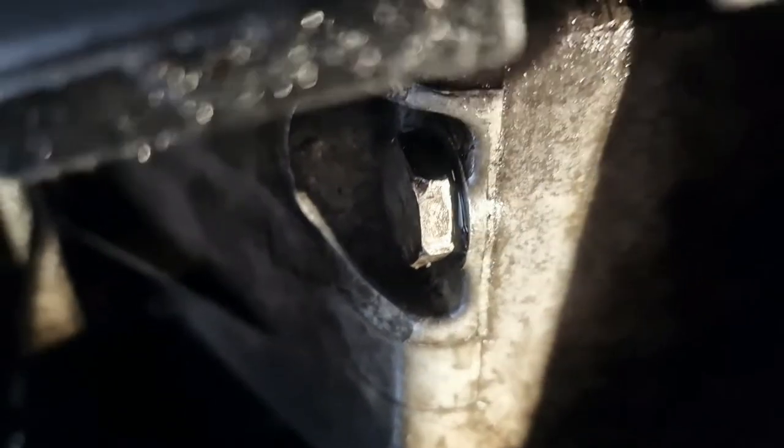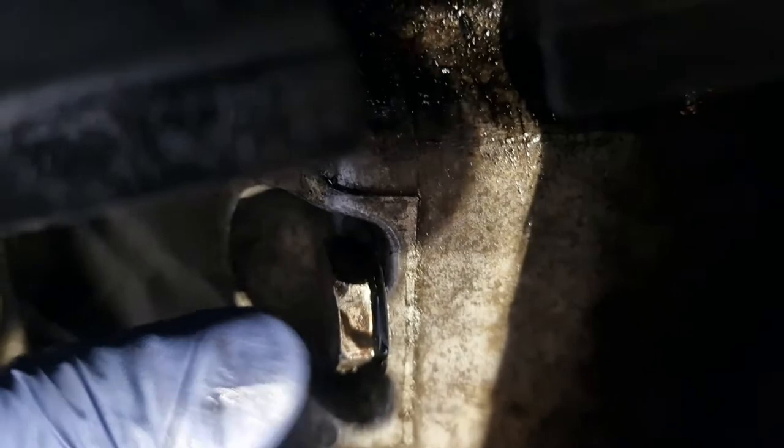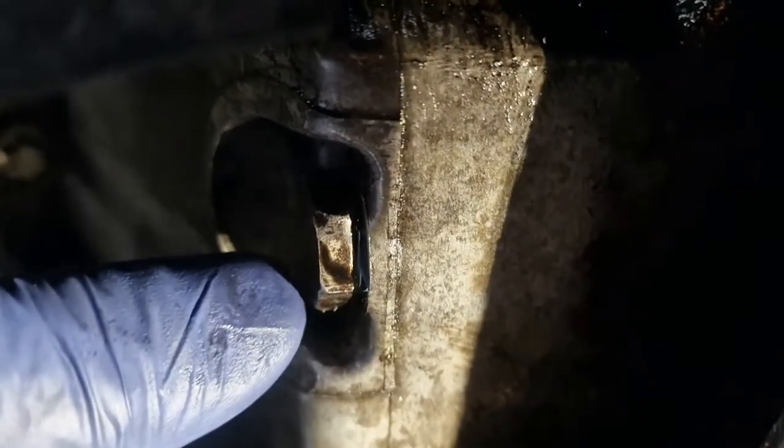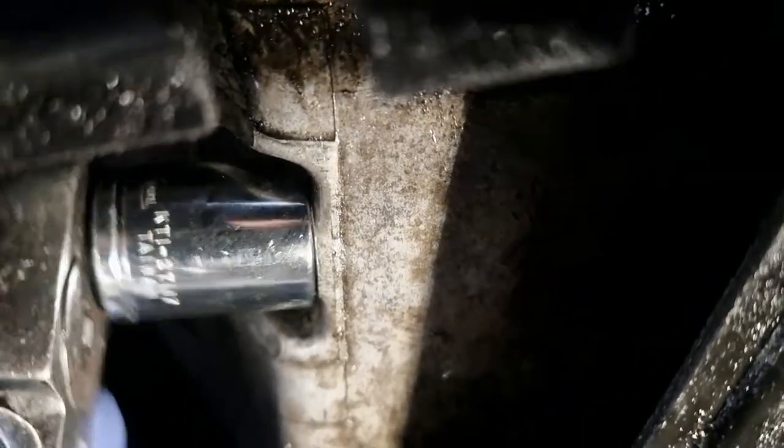As you can see, there's the sump plug over here. That one there — that's the sump plug. You need a 17mm socket to undo that. If we put this on it, look, it's turning but it's not tightening up, it's just spinning. So the thread's been stripped — that's where it's been leaking oil.